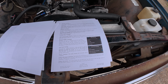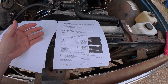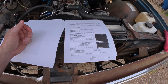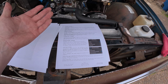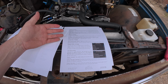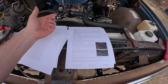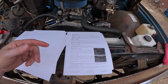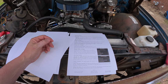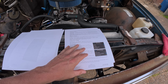The nice thing about it, like I said, is just being so easily mobile. You've seen all the videos that I've done here recently, and that's why I've gotten all these questions on it, is tuning under hood, how much easier that makes it to be, because you can sit here and have the AFR right in front of you. You can set idle mixture if you want to. You can monitor idle speed while you're doing that as well. It just makes it so easy and so nice to have something pretty mobile.